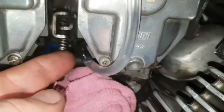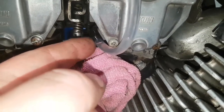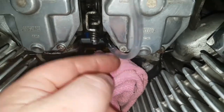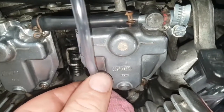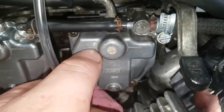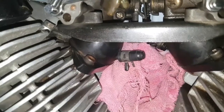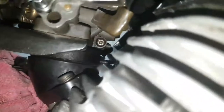You connect your pipe here, and the screw for the valve is out to release your drain screw. Here's the other side of the carb. It's a three mil pipe you need — I've used a four and it just leaks out — but it's virtually bang on with that mark. This one's set, I just need to get a new valve. You see the drain screw — you need to undo that on each carb.